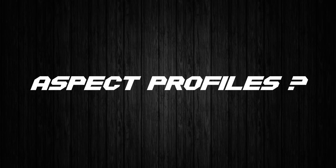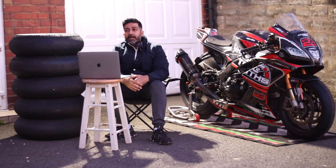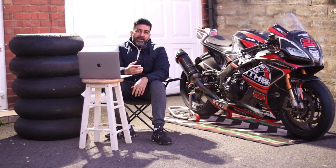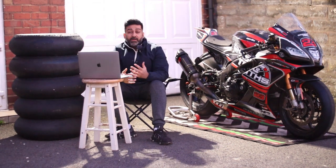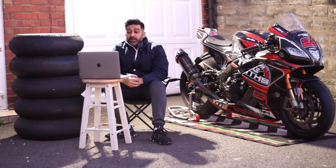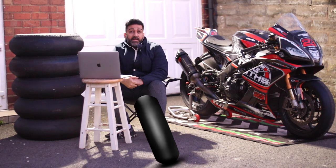Next: choice of tyre width. Metzeler TD is basically one size for the superbike — around 190 and 200, sticking to a 55 profile. With the SC3 you have a number of profile options: 60, 65, and 55 as well. So yeah, a number of widths are available. They are quite similar in many ways, but reversibility is one of the biggest differences — Metzeler TD is reversible, the Pirelli SC3 is not.